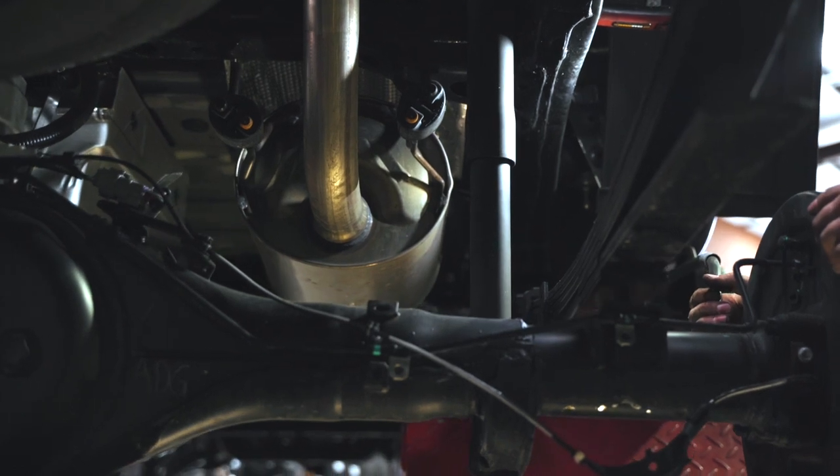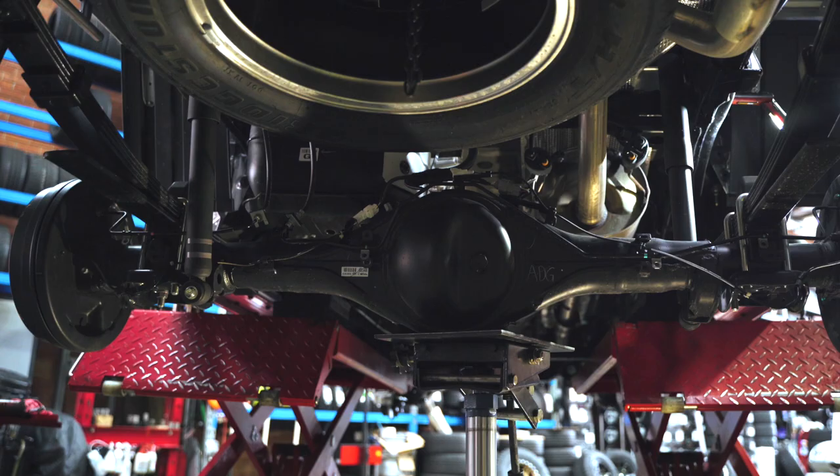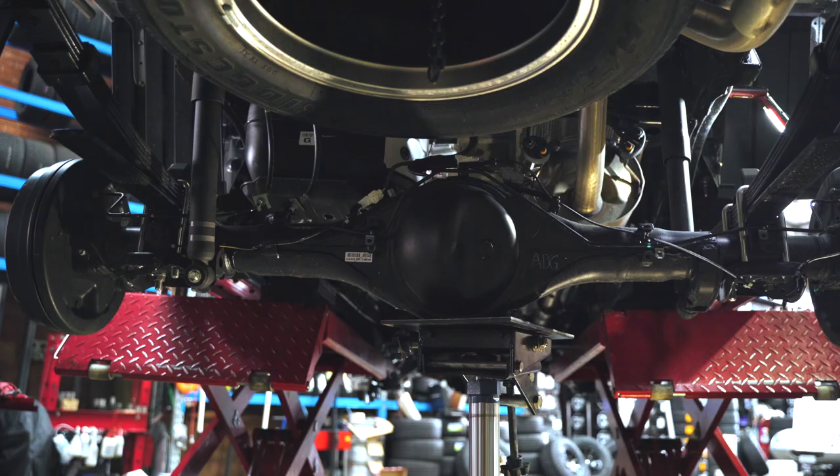The reason why we have these settings and tensions in relation to U-bolt thickness is so that we don't over-stress the U-bolt, pull on the thread, and cause a fracture within the material.